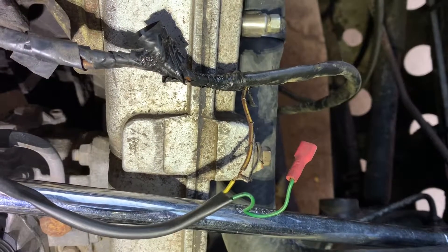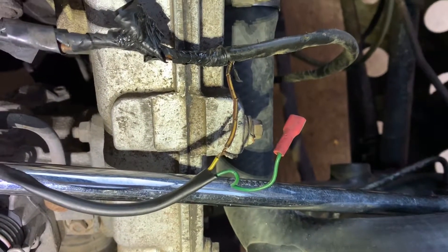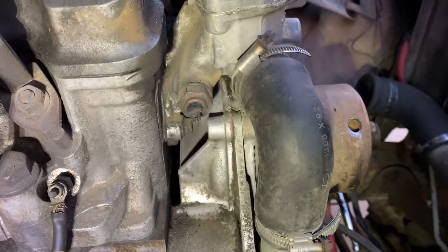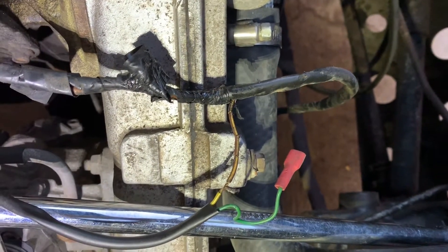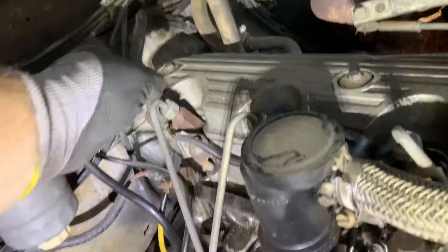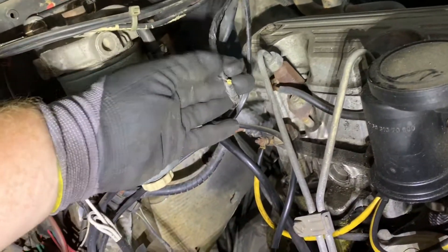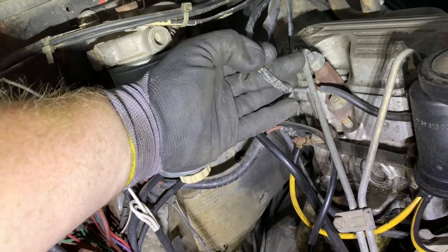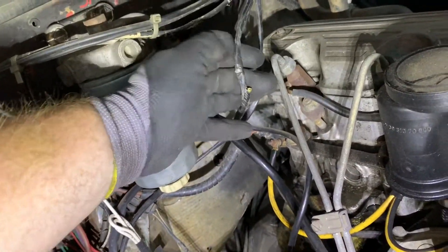There's the D-plus wire — that brown and yellow — it's all cracked. I can even see where somebody patched it right there with some soldering. That other green wire is my temperature sender. Not sure exactly what's going on there, but that insulation sure is cracked and broken. I started pulling the harness back and I've got it traced back to here. I think that goes over to the starter. And look — look at that right there, that yellow and green striped wire. What is that doing? All right, this is all coming out. I've got to make this better.